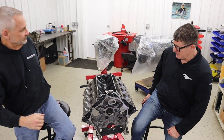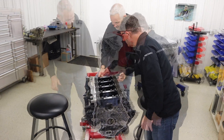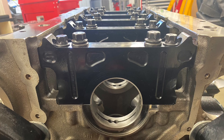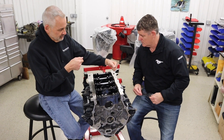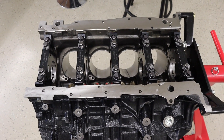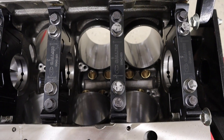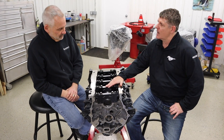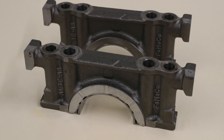So let's flip it over and take a peep. You can see the billet caps and these little wedges on the side — there's a little spot to put a screwdriver on both sides and pop that cap straight out, which makes it quite easy. The other way people pull them out is they'll drill and tap a hole and just use a slide hammer to pull it out. What's the big advantage over the stock caps? These are just way stronger than the cast caps.